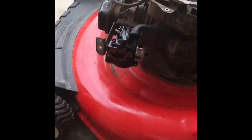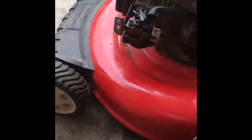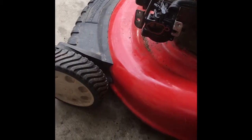This is why it didn't run — you probably can't see the color, but it's all black, like there's oil mixed in with the gas. What probably happened is somebody turned this on the wrong side and oil flowed into the gas tank or into the carburetor. There's no way it would run on this — it's all black dirt.